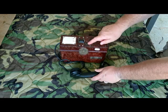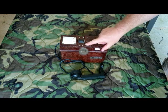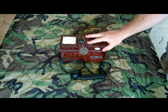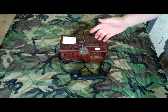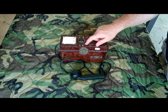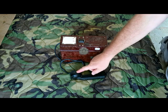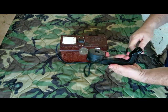There's also this button right here that engages an amplifier inside the phone. It's a little op-amp amplifier — that's why it uses D-cell batteries. Basically, all it does is amplify the incoming signal. So if you're getting a weak signal, you push that button, it cuts in the amplifier, and increases the volume or signal levels inside the handset itself. It does nothing to the microphone.